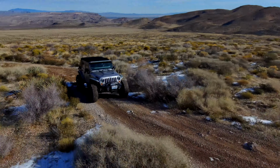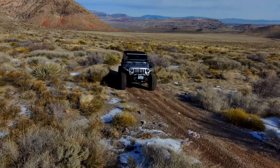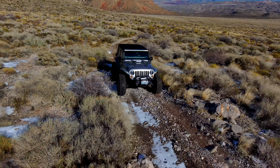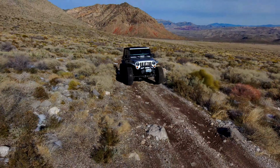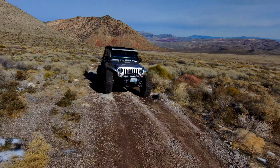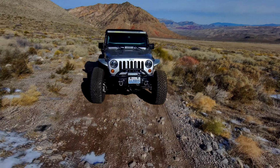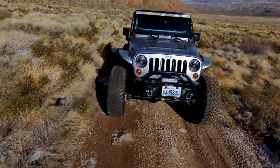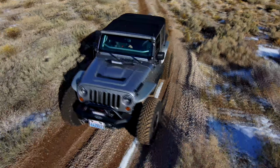No, we do not support the 8L90 with the LSs, but the 6L80, as most of you know, is a big leap up from the 4 speeds and the 5 speeds. So you're getting a relatively modern powertrain. It is not a directed injected LT, but what you're getting is well over 400 horsepower with reliability, drivability, and an engine that's been out for really over a decade and is well understood and supported in the aftermarket.